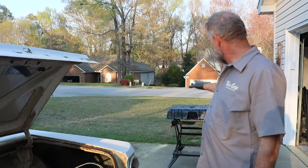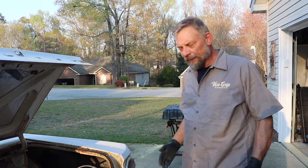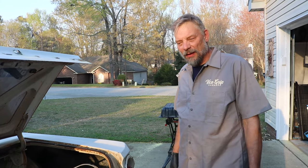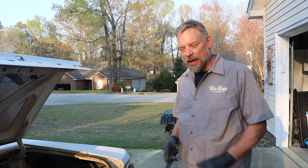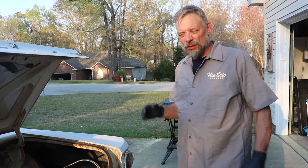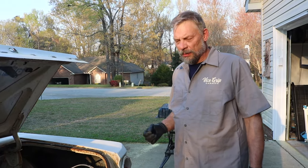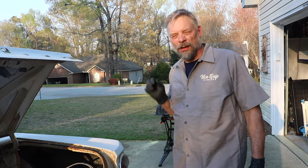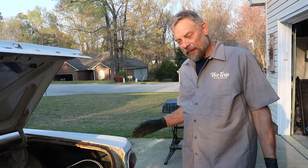Last night, we took out the fuel tank, and we took out the sending unit, and we looked it over. There is some rust, but it's not that bad. In fact, it's not that bad at all. I took it to work, steam cleaned it all up, and got all the debris out of it. It had a good half inch of just old bad gas. In fact, that varnish, they call it, plugged up the pickup tube, which is part of the sending unit, to the point where nothing could go through it. I literally had to drill that stuff out, but I got it cleaned up.